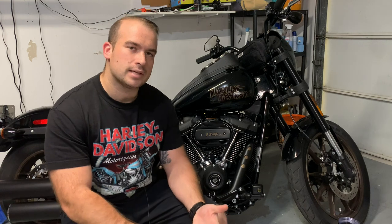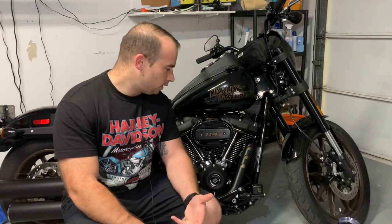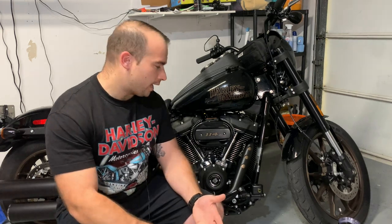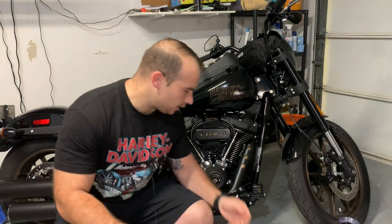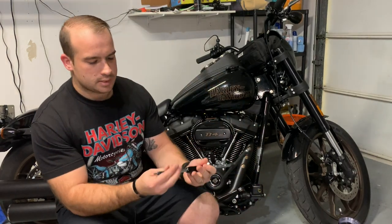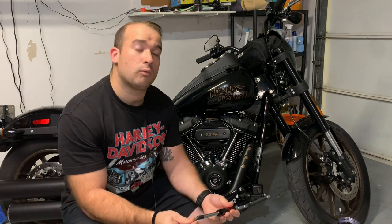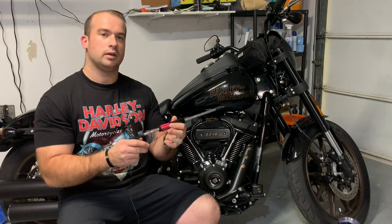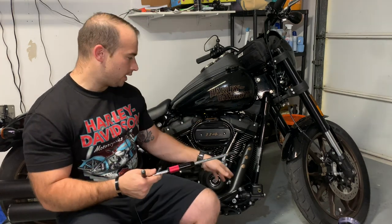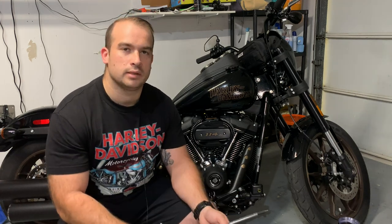I have an anti-seize lubrication, a blue thread locker, and then for me, I'm gonna have a Torx 25, a 1/4, and a, I believe this is a 7/32. Nope, 3/16. A 1/4 and a 3/16 hex, an Allen key, and then something long and kind of skinny to get in, especially on the brake side, also for the adjustable pegs on the Flow Motorsport shifter and brake pedal.